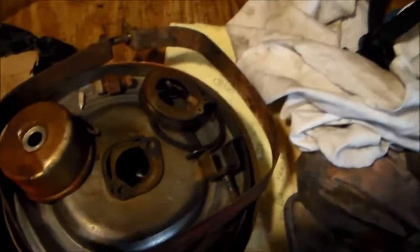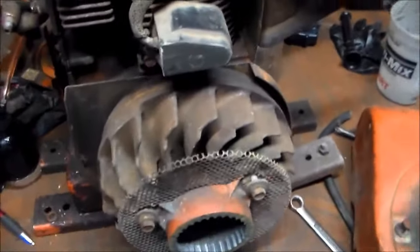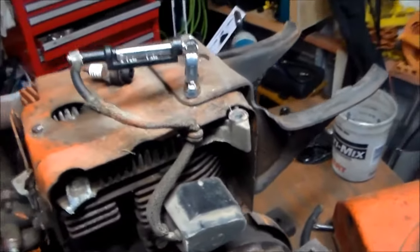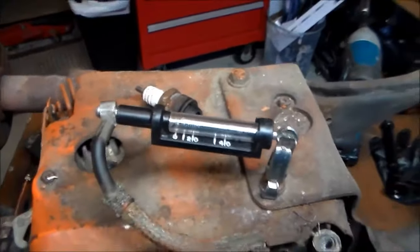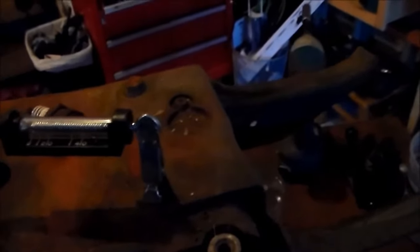The main jet is pretty boogered up as well. If there was anything in the float bowl it's probably solidified by now. I want to see if this ignition works — it could be really expensive if it doesn't. It's solid state but still uses a magneto as far as I understand. This is almost the equivalent of one of those Nova 2 modules. This is a very new engine for me, I've never worked on one of these old ones. I took the plug out just to keep the compression down.